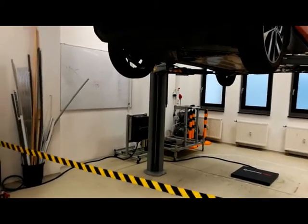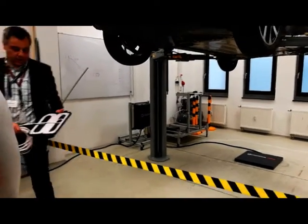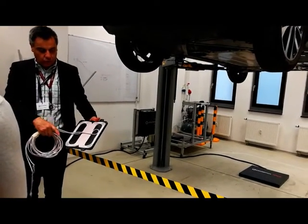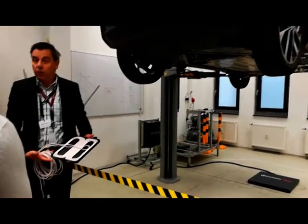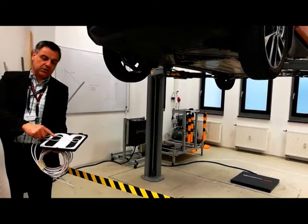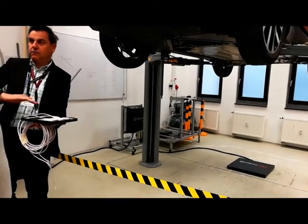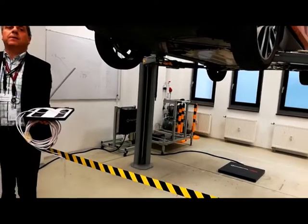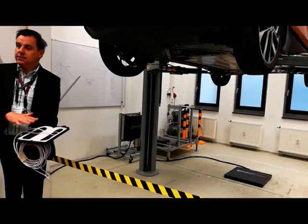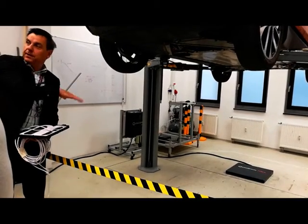Here you can see a pad and a coil winding inside. It's one coil, wound in a double D configuration — double D because we have two coil windings but in total it's one coil. The advantage of a double D is that we have a magnetic flux which is directed in a candle-light shape. It's not directed outward in a way that would heat up unwanted elements of the car. The reason for this double D structure is to direct the magnetic flux from the ground pad into the vehicle pad.